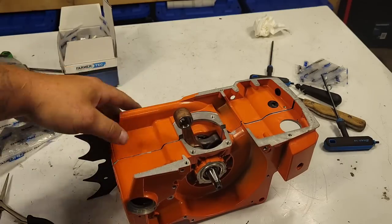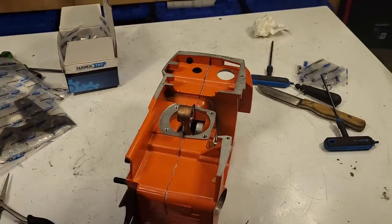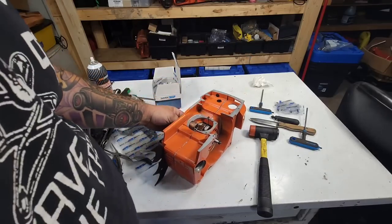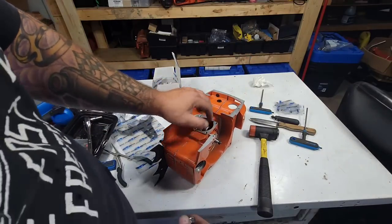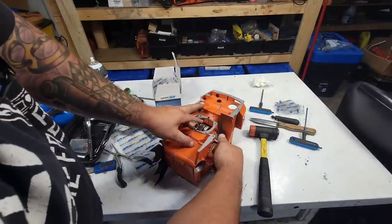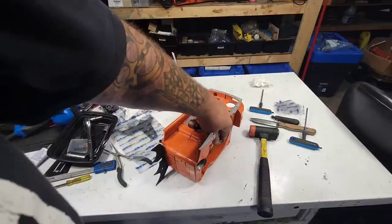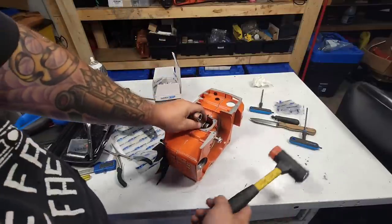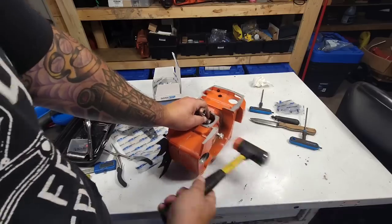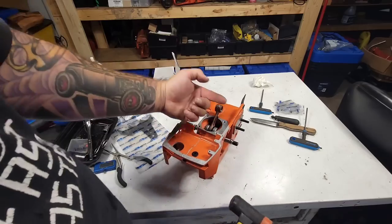That's totally normal. When you put this together, you're putting a slight side load on the bearing. Now, okay, friends, we got you backed off here. So this thing's tight, right? And we know that the crank is this way because there's less of a gap there. And what you're going to do, friends, you're going to take this nut. This is how I do it. Put it on the end here. If you're worried about boogering up the crank, okay? Take it. Hit this thing like it owes you money. Crack that way. Now, oh, we moved the crank over this way now. Ready?